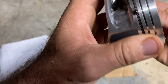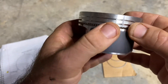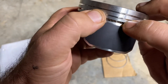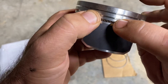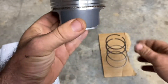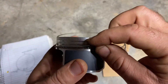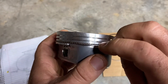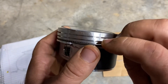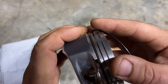Very carefully slide the oil expander ring around. Make sure the ends of the oil rings butt up together — see right there how they butt up. You don't want them overlapping, they just have to butt up together. Take one of your oil rings and start it where you want it, about 30 degrees over. Some pistons have locating pins, like the Polaris ones, so you really can't mess those up.